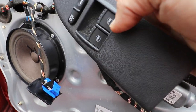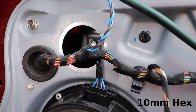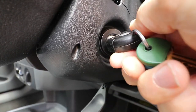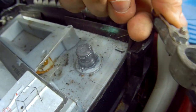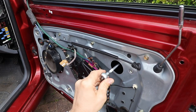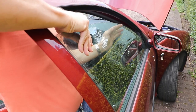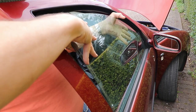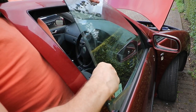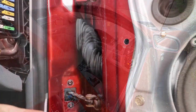Wind the window down until you see the 10mm bolt clamps through the access windows. Align them so you can get a socket and wrench on easily through the holes. Then release the two 10mm bolt clamps and unwind them until the pane becomes loose, but don't take the bolts out. Take hold of the window pane with two hands — use rubber gloves and eye protection, don't prise it or bend it. The pane will slide very closely to the door frame top edge. I found I could just drop the front edge down, releasing the back pillar side and then drawing it upwards, following the line of the door. Put that safe to one side.